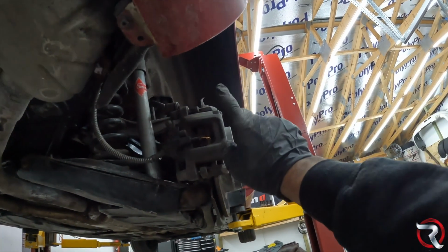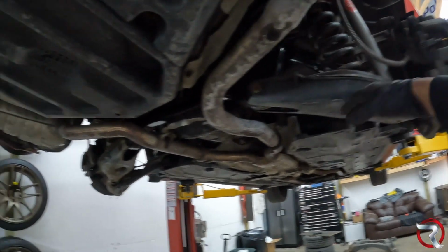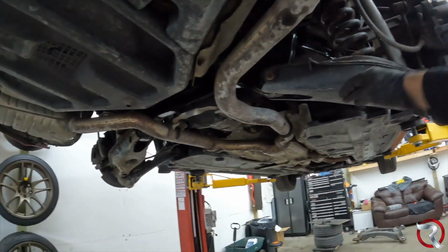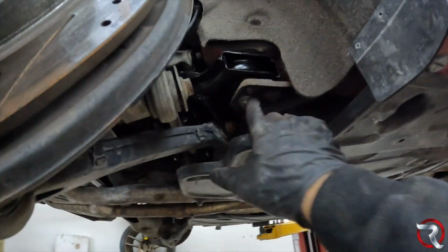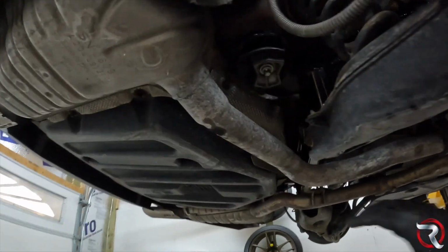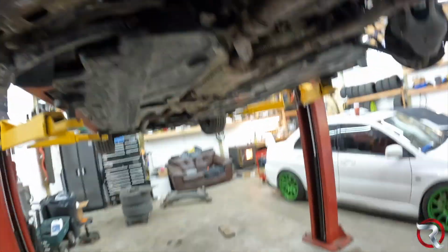That is the snow going off my roof, which is crazy. I put this little plastic piece back on. It is optional, because I don't have one on that side. So yeah, just put everything back the way you found it. Make sure you get all of these nuts and bolts all together. Make sure that there is no gap between the body and the subframe. Make sure that's all good, and then we can start to let this bad boy down.